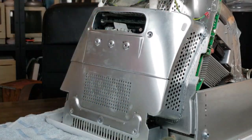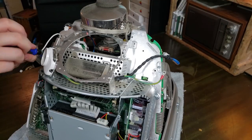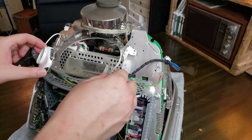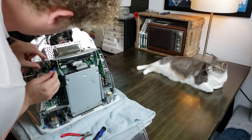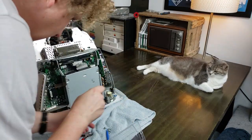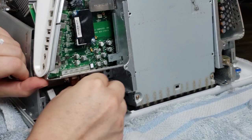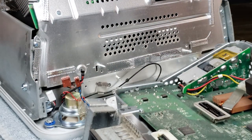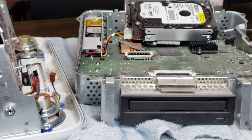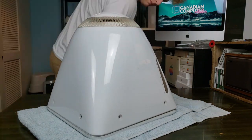Continuing our journey to the center of the eMac, we remove the back plate near the motherboard, CD, and hard drive. Pull off the fan chassis, which also has a zip tie. Disconnect the cable from the CRT to the motherboard. Pop these four little connectors off — just hanging out front of Satriali's like the Soprano crew. We get a first look at the motherboard. This was the end of the first night, and I didn't want my cats to shock themselves, so I put that cover back on top.